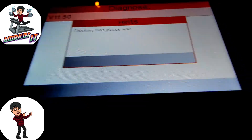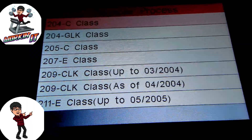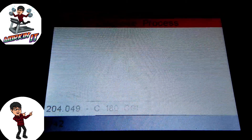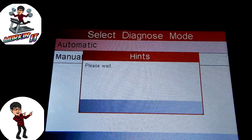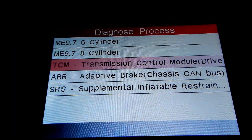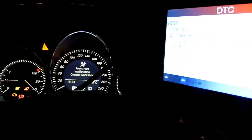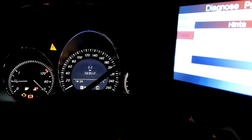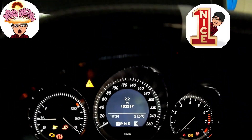To clear the airbag code, go to Scan and select your model car. Mine is a W204 C-Class, gasoline, right-hand drive in Australia, model C300 — which also works for the C280. Then since it's an airbag fault, we go into the SRS area. We read the fault code and it tells us the airbag stage has access for high resistance. Then we exit, go to Clear Fault Memory, and bam — trouble code successfully removed and no more error. Turn the car on and off again.